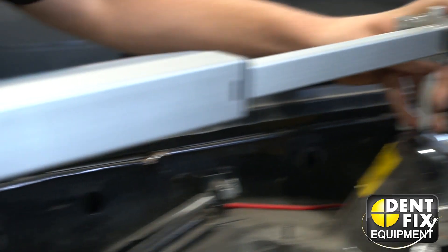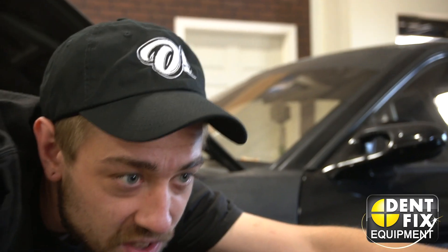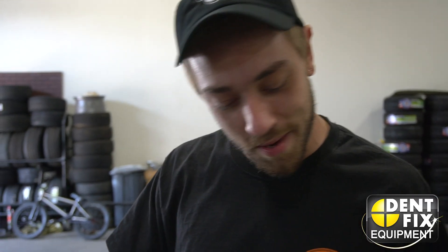We can do a length measurement. And we have 265, right? Add 400. Which if you're just doing comparison, it doesn't really matter. So sometimes I just take that 265 number. And we go to here, and we have 249. This car has definitely moved around a bit.